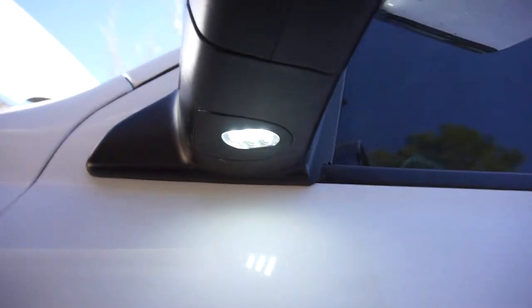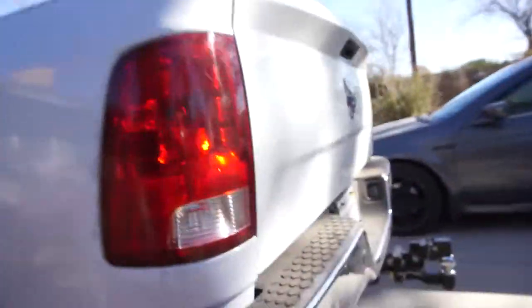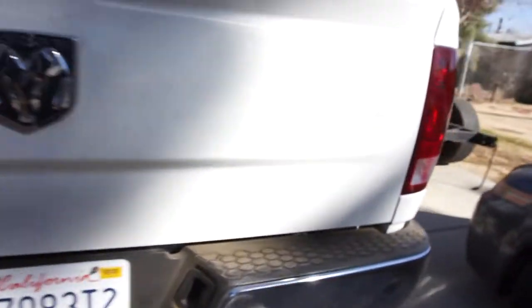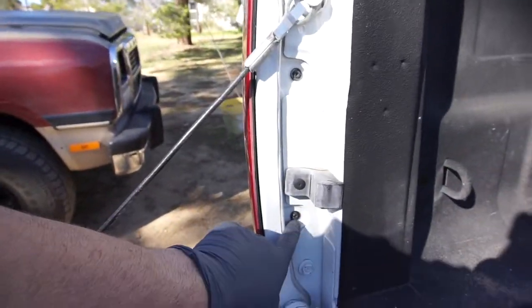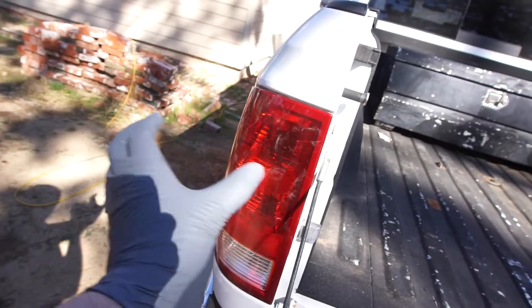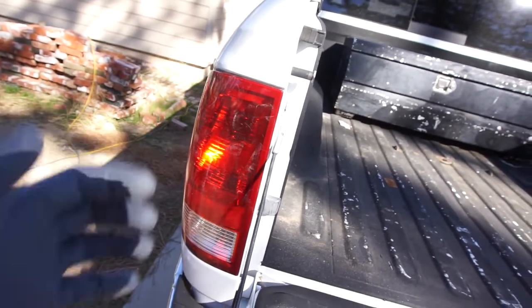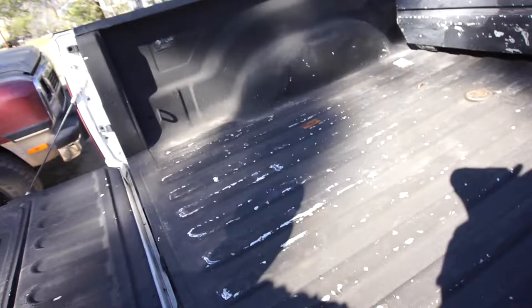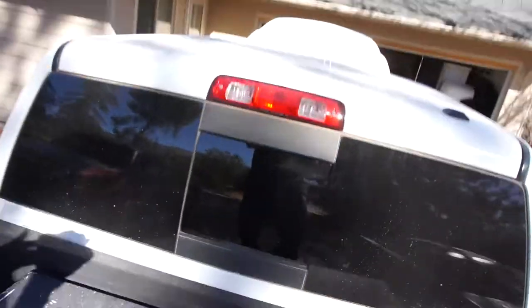Here are the mirror floodlights — I'm gonna have to change the settings because they stay on for quite a while. You can kind of see the LED bulb in there. The reverse lights are pretty easy to do other than the clips breaking. You just have two screws — one here, one there — loosen them, and then it slides out away from the truck, whereas my old second gen it came towards you. Make sure you push it out away from the truck.